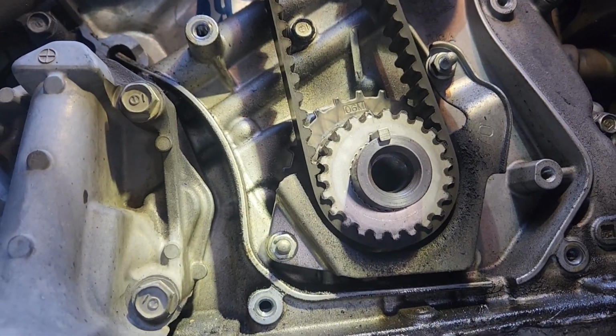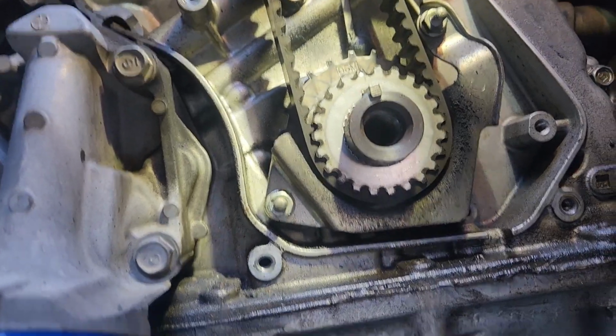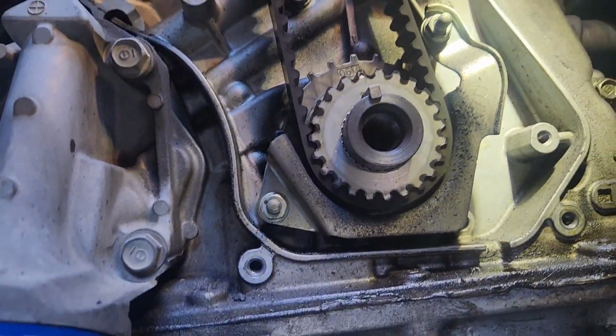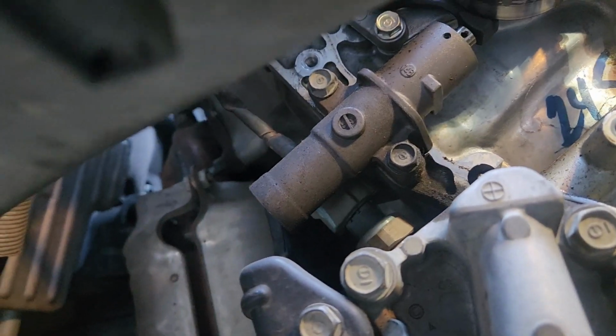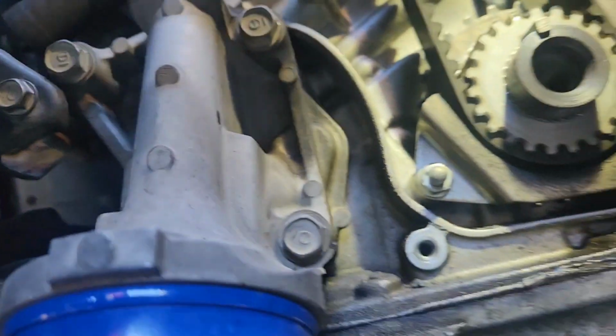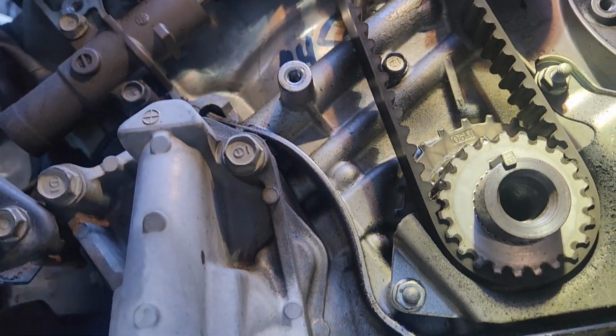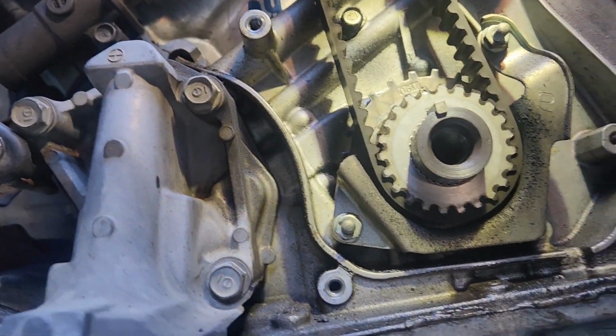That's because we're using the advance mark to time it. It's the same deal with the cams. This will prevent the cams from rolling. Typically, it's the best way to go about it. So now I'll pull these 2 bolts for the belt retainer down on the crank cog, and then the 2 bolts right there that retain the tensioner, and then the belt will go slack. We'll pull the belt off, get a pan under here, and start to pull the 7 bolts that retain the water pump out, drain the water out of the block, and go from there. I'll get back with you.